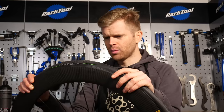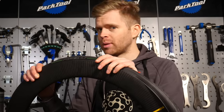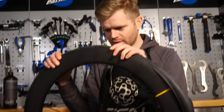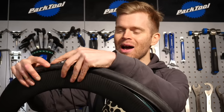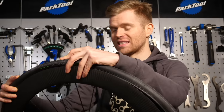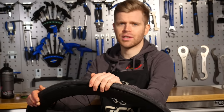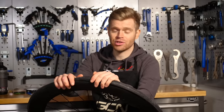Once you've cleaned your tire and wheel from the old sealant, the best thing to do is to dry mount it onto the wheel without the sealant in, and then use your compressor pump to seat the bead and inflate the tire, rather than putting sealant in first. You know you're a true road cyclist when you're fit enough to ride up category climbs, yet you get out of breath trying to put a tire on a rim. I bet even Chris Froome gets out of breath trying to fit his tires on his rims.